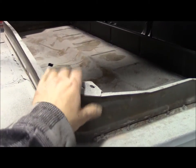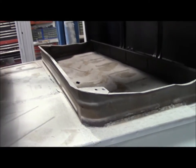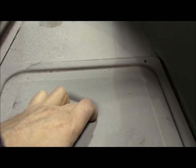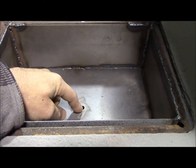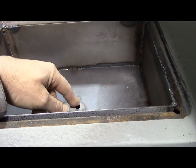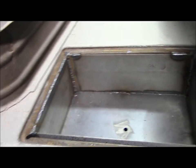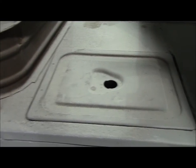What we're going to do is cut this seat brace out of here, because he's got a newer seat out of a newer truck that fits in here beautiful. But I've got to get rid of this and make some leg extensions on the other seat. If you remember, I made that little box thing I was telling you about — because up on the firewall is where he's putting his battery. He doesn't want his battery under the floorboard. So what I did, I didn't fill this in, I put that box in there. I did put a drain hole — I was only joking about the beer situation — but I put a drain hole because it is down low, so if there's any water or moisture, at least it can run out. This is a good place to hide personal things, like your camera or wallet, or keep tools in there. When you put your carpet over top, you'll never know. It's a good little cubby hole.